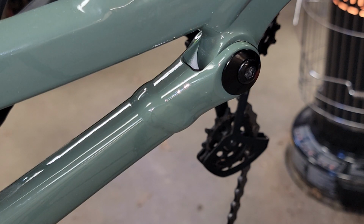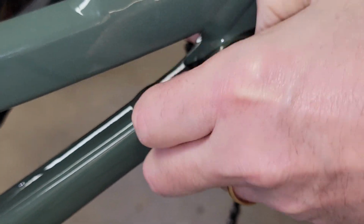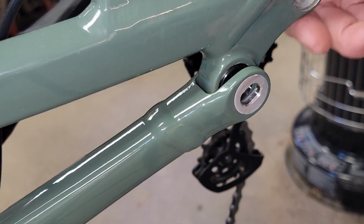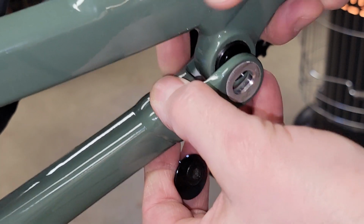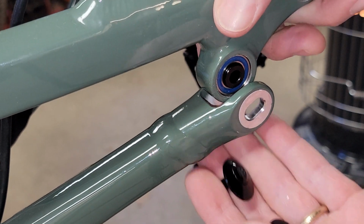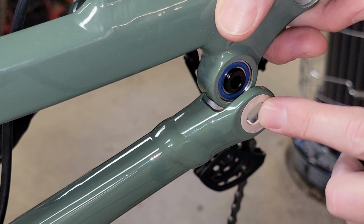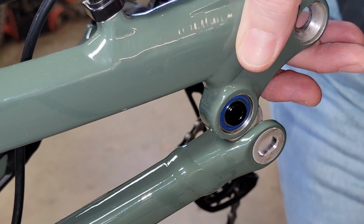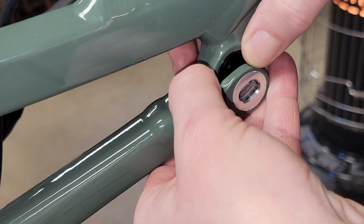So you pull your back cap off, grab your bolt and your front cap. When you do that, you'll feel your suspension loosen up. Let's lift this up a little bit. Basically what you're doing is, this part right here, you're moving it either forwards or backwards. So now let me fiddle around and try to get this spacer back in there. I didn't quite want it to fall out, just like the back one just did.